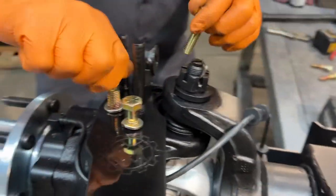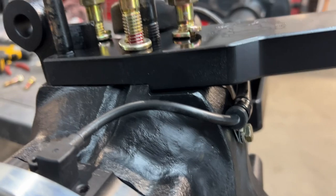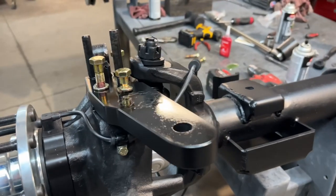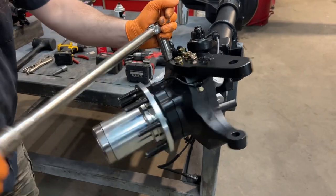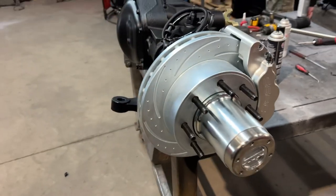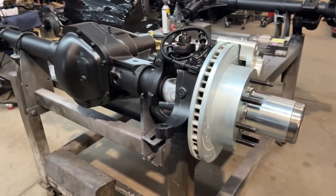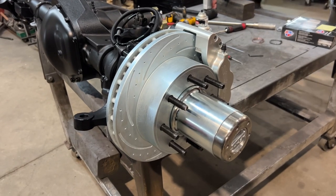A little bit of red Loctite on these bolts and we're going to screw them in and torque them to 150 foot-pounds — that's a part you definitely don't want coming off. The steering arm gets five grade 8 bolts to hold it down, and it's keyed, so it's a super strong setup. With a little bit of red Loctite, they're not coming out. Final step — torquing the steering arm. That's it, there's the Spintech hub install. They're going to install the rotor and caliper now; this axle got the SSBC calipers and rotor upgrade, which is an option but not required. Thanks for watching — leave questions in the comments or shoot an email to Chris at ujointoffroad.com. Be sure to check out our website.